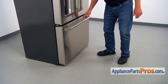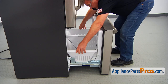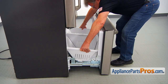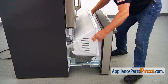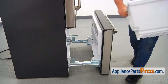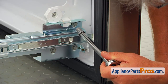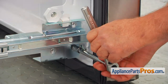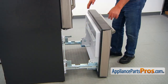To get to the part, we need to open the freezer door. Now I'm going to remove the drawer from the freezer and slide it out. Next, we're going to use a 3/8 inch wrench and take out three bolts here that hold the door — three on each side. And now we're going to lift off the door.